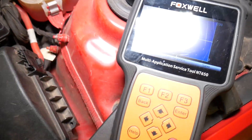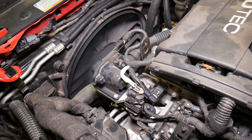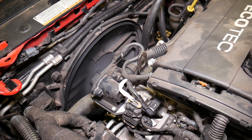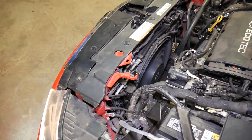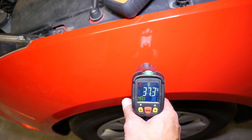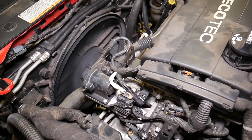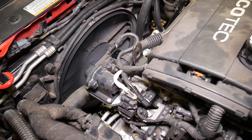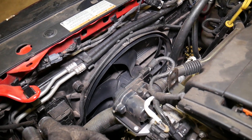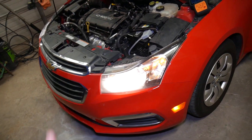You can see the coolant temperature is at 100 degrees — it turned on at 108 degrees Celsius. Outside it's super hot right now, around 37 degrees Celsius, which isn't helping things cool down fast. In cold weather you'll be able to cool everything much faster. After a while it did turn off at about 98-99 degrees Celsius, and the radiator cooled to about 40 degrees Celsius. So to summarize: at 108 degrees Celsius, that's when your fan will turn on. Hopefully this video is helpful — thank you for watching, please subscribe, and see you next time.